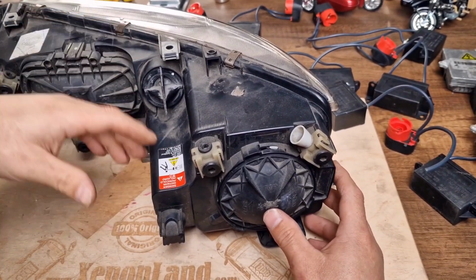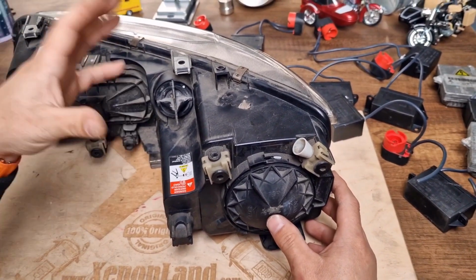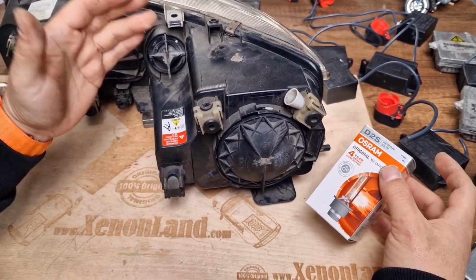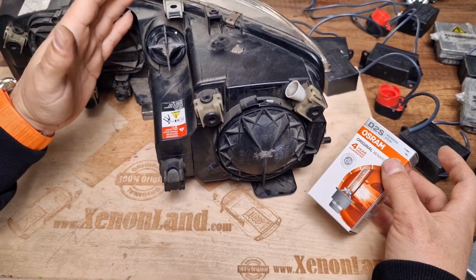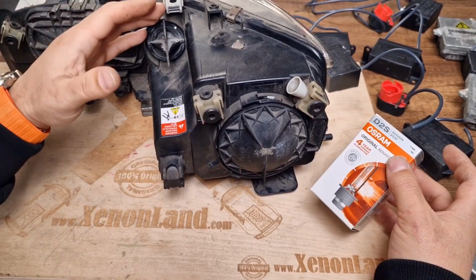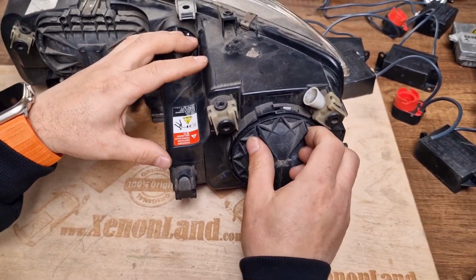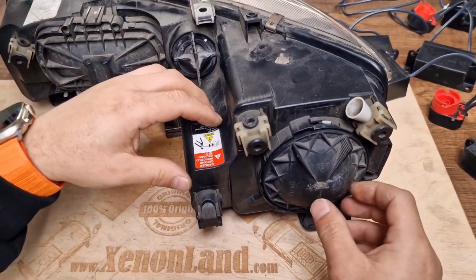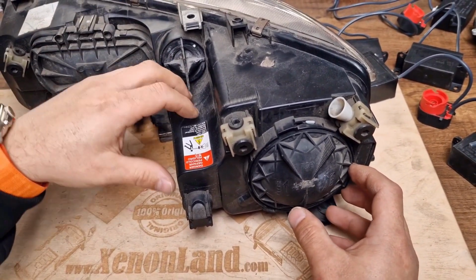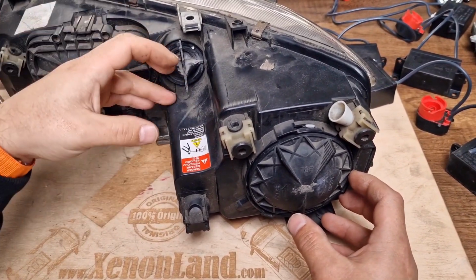Although there are a lot of videos out there on YouTube, you can also see them. If you are sure that your faulty part is the xenon bulb, you can try to replace it by gaining access under the wheel arch of your car, removing the fender and trying to reach your back cover from the wheel arch. But as I stated, officially the safest way, in order not to break any part of the headlight, is that Mazda takes off all the headlights from the car.